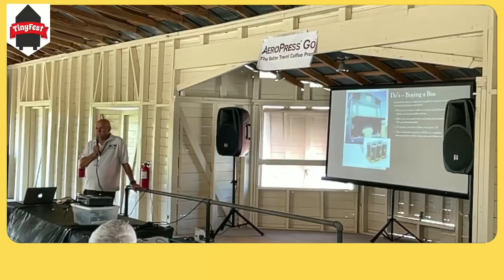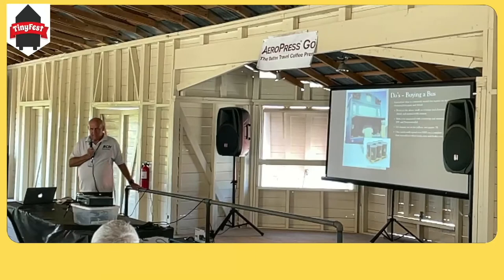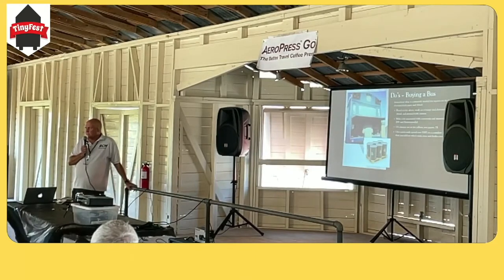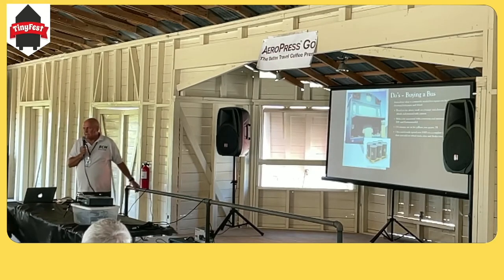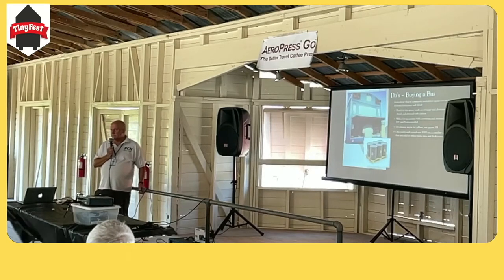Oil changes are in gallons. I just changed my oil. It took 9 gallons. And if I would have changed the fuel filters, which I usually do, you're talking $300 for an oil change if you do it yourself. If you hire it out, it's $500 for a service change. And that's not even including grease in the chassis, and there's 132 grease fittings in my bus. So if you don't know how to grease a bus, you're going to have to pay somebody to do that, okay? So if you buy yourself a grease gun and get under there and grease it every year, you're all set. You can save a lot of money. Grease is cheap, but it's a chore. You've got to do it or your bus is going to wear out parts prematurely and squeak and stuff like that.